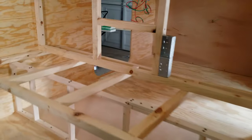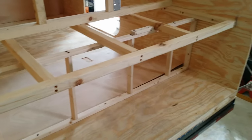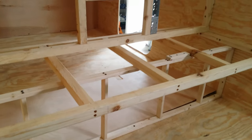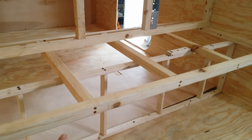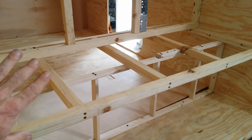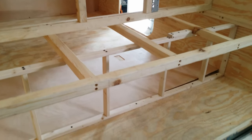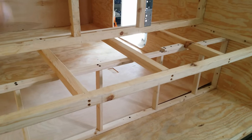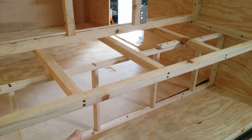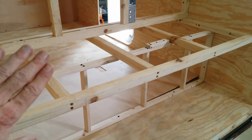First reason is we actually built this camper to accommodate a residential full queen-size mattress, so that's why the galley is so short on the bottom. But the reason I did that bottom wall that way is — if she decides she doesn't need that extra room inside, she can always buy another mattress. We're going to make the panel in the galley removable so she can move that wall back if she ever decided to get a smaller mattress. Right now this is an eight-foot-long camper and the mattress is 78 inches long, so that leaves very little room. We offset the cabinet and the bulkhead to give her the room she needs on the countertop, but that wall at the bottom — should she ever get a shorter mattress — she can take the screws out here and in the walls and move that whole wall back to give her more room in her galley.